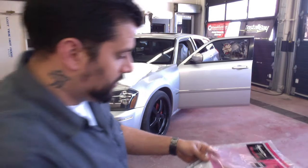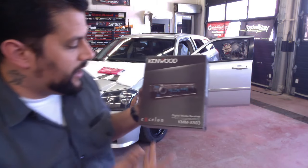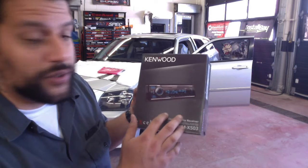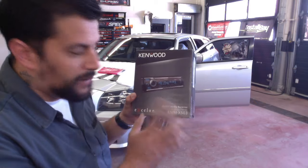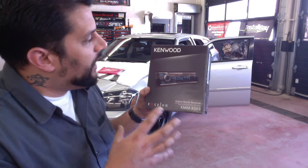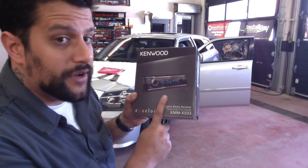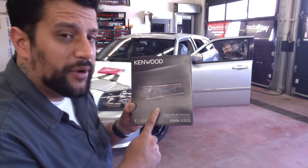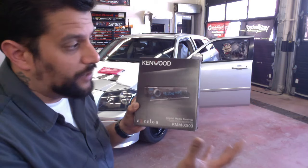The fit and finish is beautiful inside. The 2020 Kenwood KMM-X503 is a mechless, meaning no CD player. Something important to keep in mind: newer JVC and Kenwood radios have a slightly different protocol for steering wheel control. Sometimes the newer Kenwood radios may not auto-detect or program properly because they've changed their steering wheel control input/output protocol. So you may need to reconfigure the ASWC to JVC mode on a Kenwood radio.